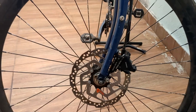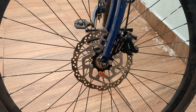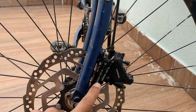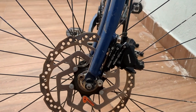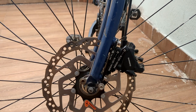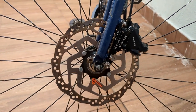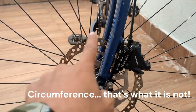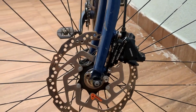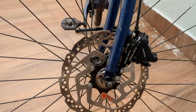So I thought about putting a 180 millimeter rotor on a road setup. Originally I thought that these adapters — as you can see, these are adapters for the rear brake, going from 140 to 160 millimeters — for each adapter I could go 20 millimeters more on the diameter of the disc, because diameter is a linear measure, not a radial one.